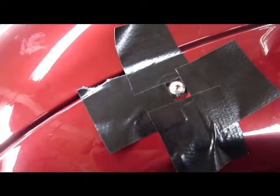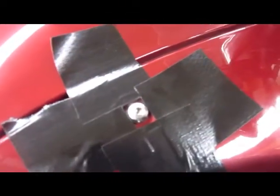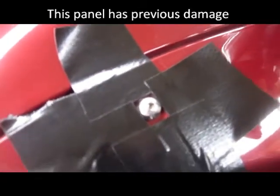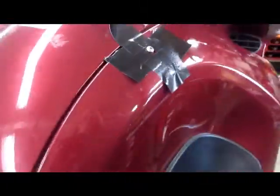The problem with the stainless ones is they're very difficult to start, which leads to people cross-threading them, and then they keep reefing them in until they fuck up and screw the nutsert up in the tank. That's the case with this one. The fucking thing turns and turns and turns and turns, and even clamped on with vice grips and pulling on it and turning it, it will not come out. So you are left with nothing to do except to drill the fucker.